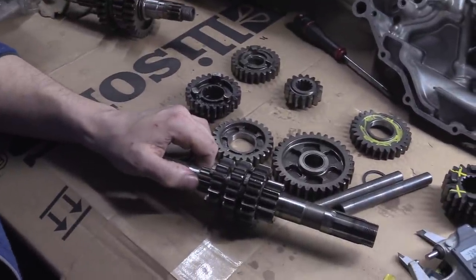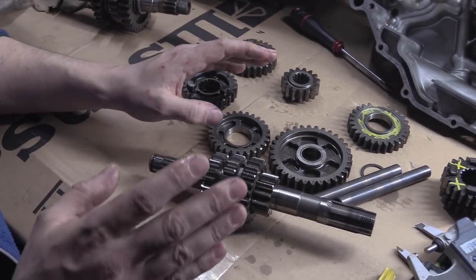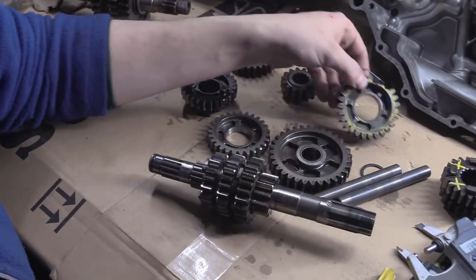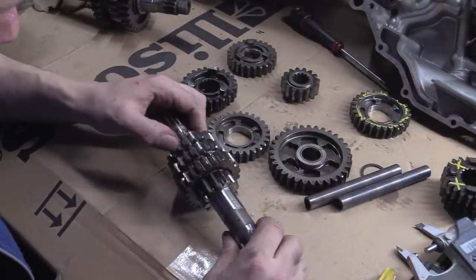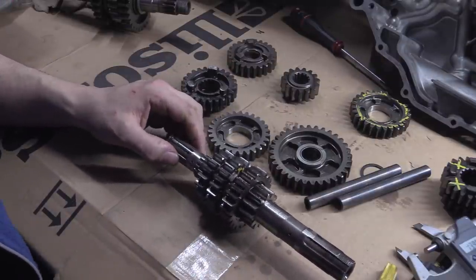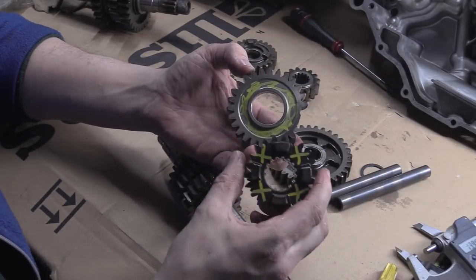What I've been doing is visually checking all the teeth of all the other gears. Your eyesight and brain are very good at pattern recognition, but with gear teeth everywhere you can get lost in the noise. So I've literally just been concentrating on one gear and scanning through the whole set, looking at all the teeth to see if they're damaged. I've also marked up this gear on both sides and crossed them off so I don't accidentally put something back in.